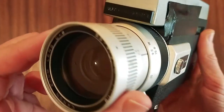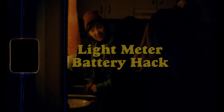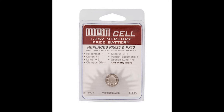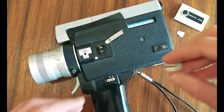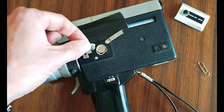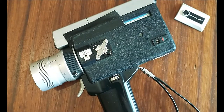Now for that light meter battery hack. The original battery for the light meter was a mercury button cell, which has been discontinued. You can get a replacement zinc-air battery, but I've been using two Energizer A76 button cell batteries, some rolled-up cardboard, a piece of folded-up foil, and a paperclip. I place the two button cell batteries in the rolled-up cardboard so they're snug and secure, then put the folded-up foil on top, and finish it off with a paperclip latch — then replace the cover.